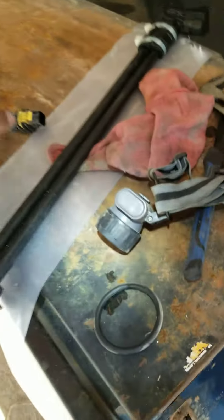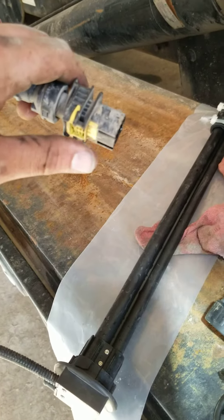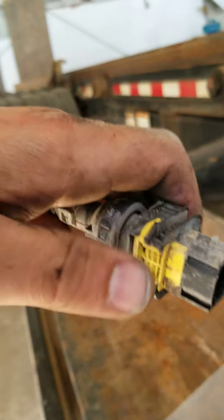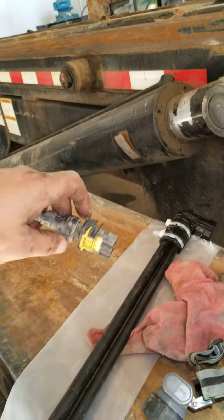The other thing — I can't show you the other side of the tab, but on the connector piece there's a big yellow tab on the outside. You've got to stick a screwdriver under it on the outside and pull it straight out. It's a push — you push it back in to lock it together. So don't get too crazy with it.